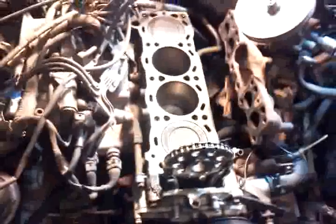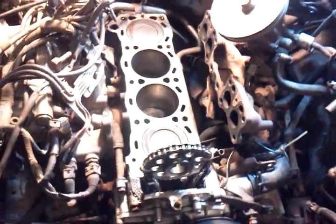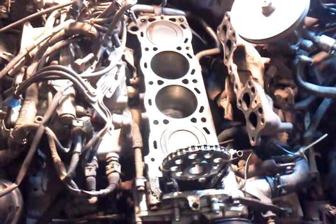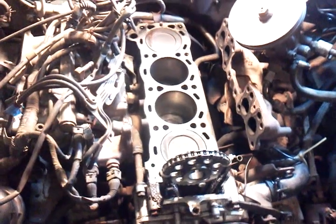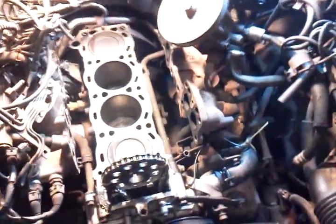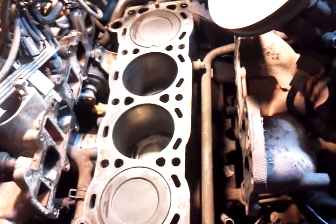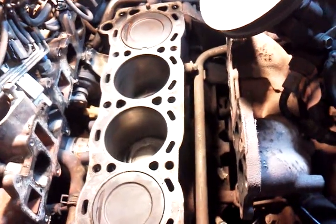where you can buy a timing chain kit that's with a metal guide, new chain, new gears, new timing cover, new water pump, oil pump, all the gaskets for $122. And shortly after, I started getting water vapor in my oil, so I just assumed it was a head gasket. Well, as you can see, I'm in it pretty deep.